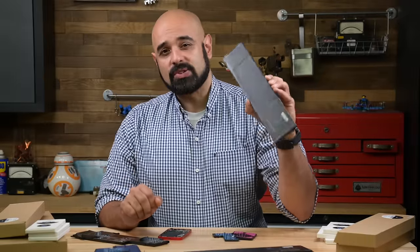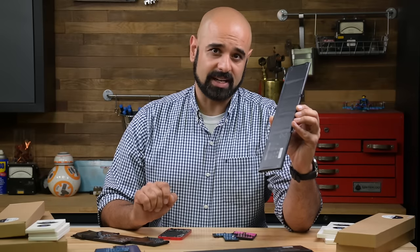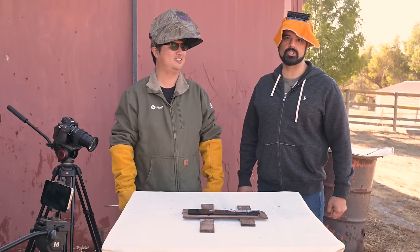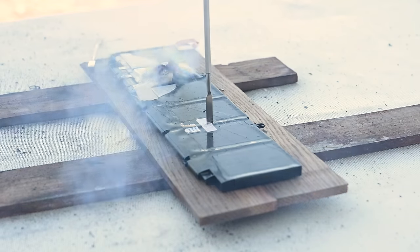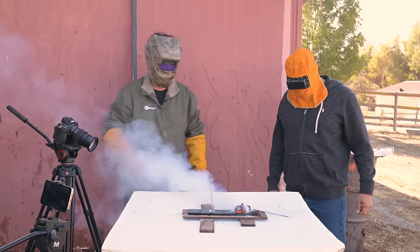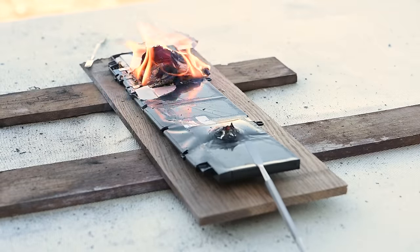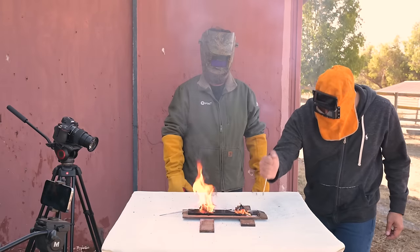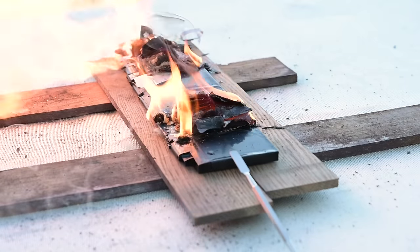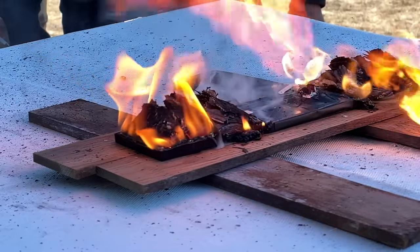And when it comes to batteries, size really does matter. Let's see what happens when we puncture a 97-Wh laptop battery. This thing is about seven times bigger than the 12 Pro Max battery. For most folks, this is the biggest battery you're going to encounter during a repair. A fully charged laptop battery — bigger battery, more electrolytes, bigger reaction. And that reaction occurs across multiple cells. So in real life, you could potentially be looking at a fire that spreads across the battery over time. This shows why glued-in batteries are such a poor design choice.